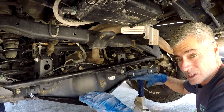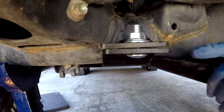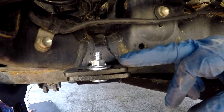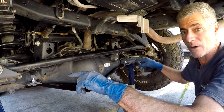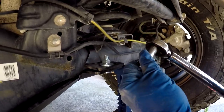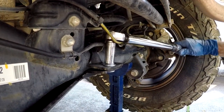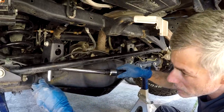We brought the nuts down equally on the rear and front and noticed that now there are about six threads showing above each flange nut — that's how we can tell the brackets are tightened down equally. Now we're going to transition to the torque wrench and get these torqued to 23 foot-pounds. On this side, a long 14 millimeter socket works best — you slide it in between the ABS line and the brake line to get on there, and that's already at 23 foot-pounds.